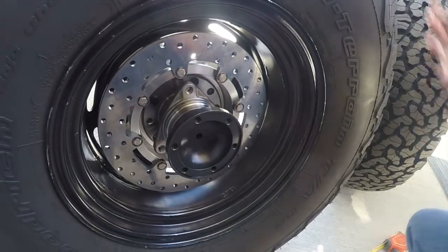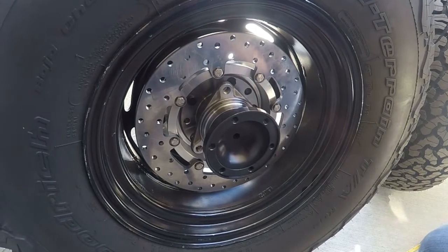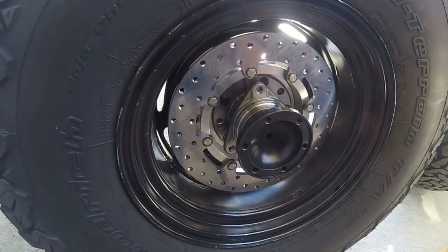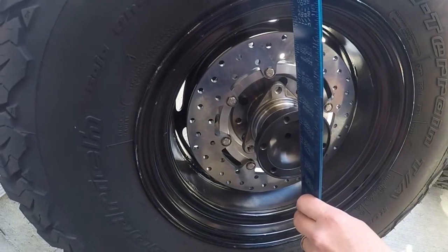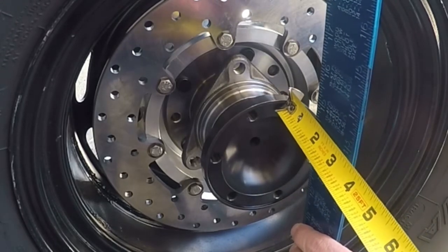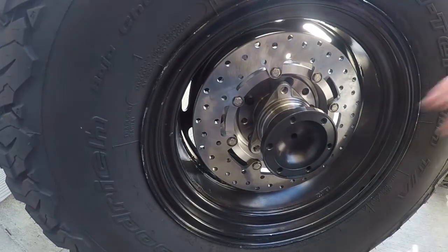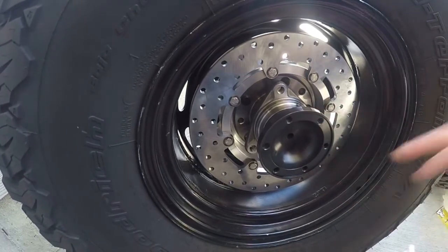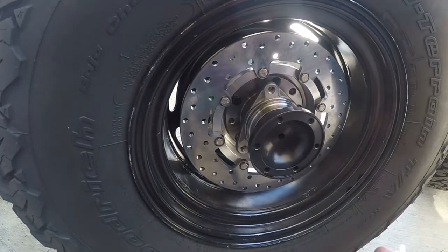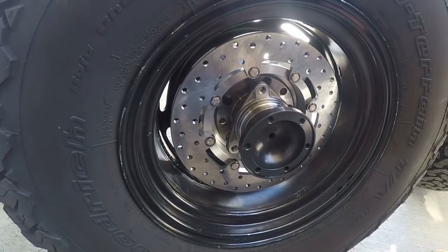What you're looking at here is the same tire mounted on the same wheel, but this one has a micro stub bearing housing and a disc brake setup mounted on it. If I put the straight edge on the outside edge of the tire like I did before, that's 1.75 inches. Comparing nothing else, if you just compare the micro stub against the Volkswagen Type 1, your axle is going to be 1.75 inches longer. The benefit of that is, for the same setup and same angles on the drive shafts, the longer the drive shaft is, the more travel you're going to get.